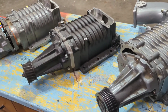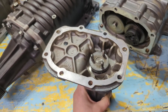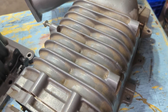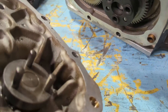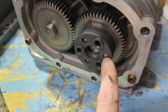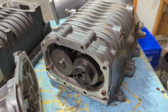First, I'll start with the similarities. You can see that the snouts are physically the same exact thing — there's no difference between a Cobra and a Lightning. The rotor pack is also the exact same dimensions, with just one small difference we'll cover later. Behind here you can see there are straight-cut gears, and basically a coupler that unites the three pins on the snout side to the three pins on the actual supercharger side, transmitting motion from the snout to the rotor pack.